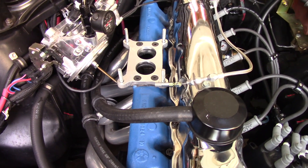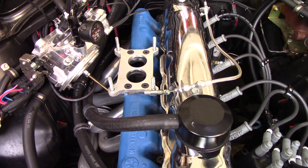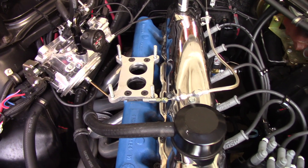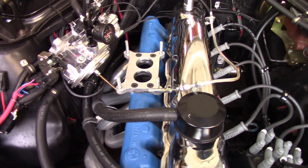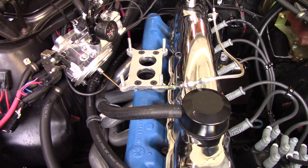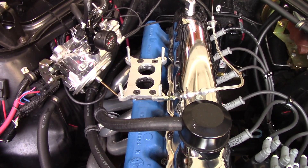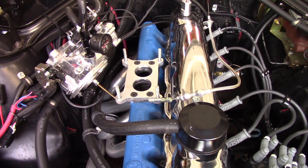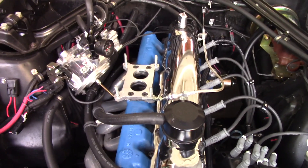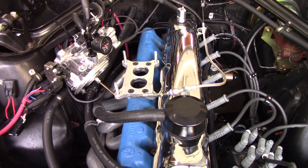This is an easy fix. We don't need to braze this to fix it — it's a pinhole leak. There are various epoxies that will fill that just fine. There's no reason to panic or rip the head off and take it back to Jeff. I already spoke to him about repairing it this way. It's a fairly common issue. So I'm going to mix up some two-part epoxy and fill that hole, get it real clean with acetone, fill it, put some tape over it, let it sit for 24 hours, and that should cure the problem.